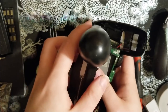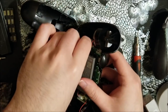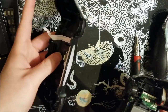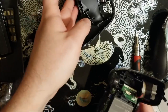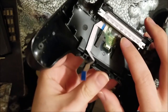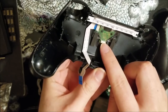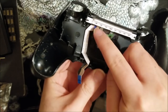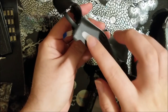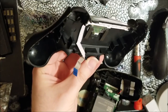We're going to want to detach this cable for the USB in the back as well as the light bar — just get that out of the way. That's literally all that's in here. Interestingly, the RGB LED is mounted on the USB board, and there's a big light pipe — a clear piece of plastic — that goes over, with the diffuser inside. I thought there'd be a vertical PCB or something, but that's an interesting solution.